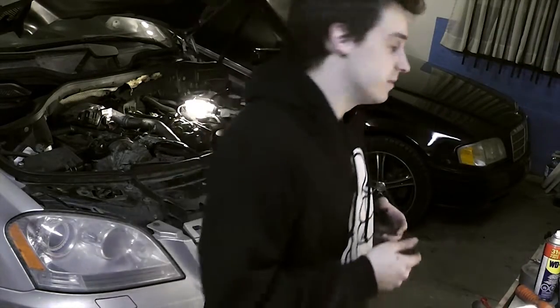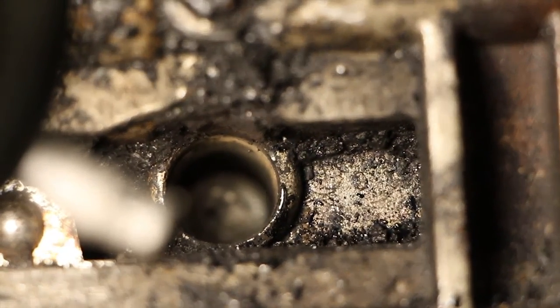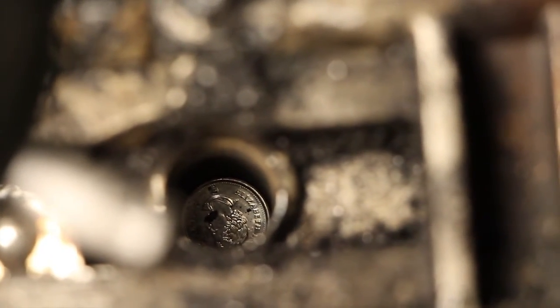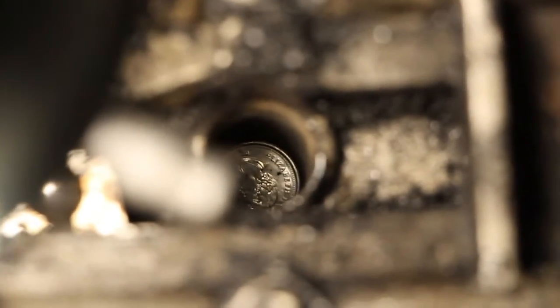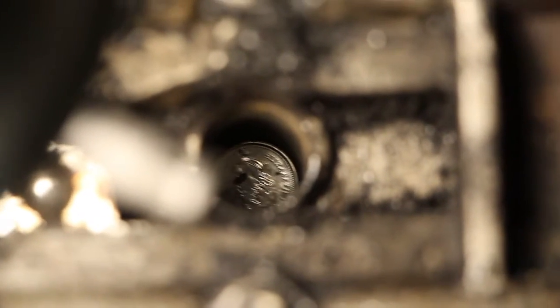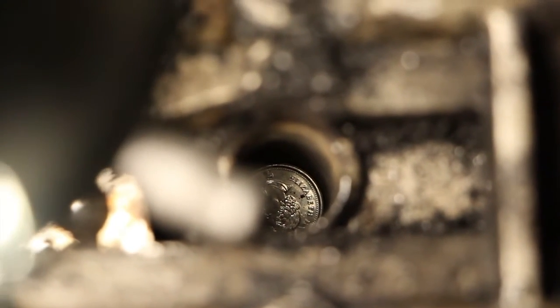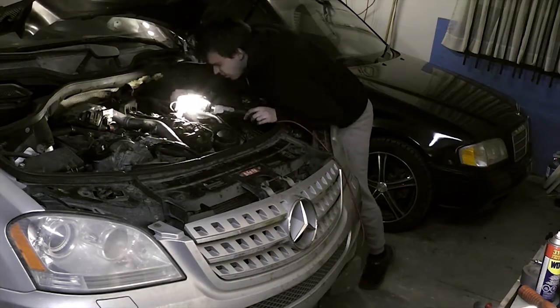It took me a couple of tries to get it right. So here you go - this is the hole the fuel injector goes into. A perfect fit. Now you might be wondering how you're going to clean the tube out. It's not terrible, but I'm going to clean it out with a little brass wire brush. I'll just spin it by hand with an extension - it should work fine. A stiff wire brush on a stick is all you will need. The tube really doesn't accumulate much dirt.